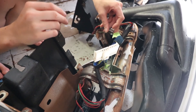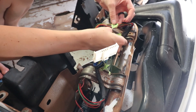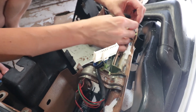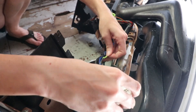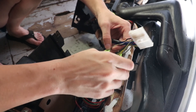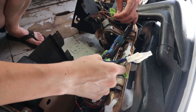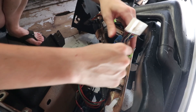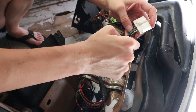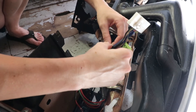I'm going to start with the dash. I've previously gone ahead and marked all the wires that we're going to be cutting. Yellow and red is oil pressure, black and blue is temperature, yellow and blue is tach, white and red is the alternator, and black and yellow is 12-volt tach. The tachometer one is the only one I'm not 100% sure on right now — I think we're going to have to run a resistor on that, so I need to look more in depth before hooking that one up. For now we're going to hook up the alternator, the temperature, and the oil pressure.